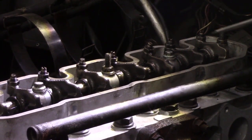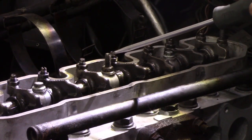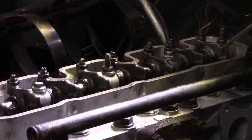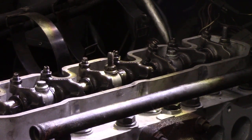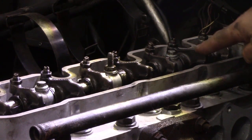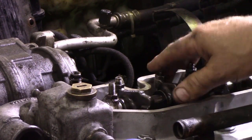I've zoomed in so you can see these valves. The firing order is one, three, four, two — always has been, always will be. Now, if we see these valves at the back rocking — a lot of people use the 'rule of nine' but I never bother with that, that's a waste of time. I'm going to turn the wheel backwards — keep your eye on this rocker. You see it went down, watch when it comes back up. Just ever so slightly, look at this one — it's just going down. That means we can set the valves on this one because we know this one's firing.